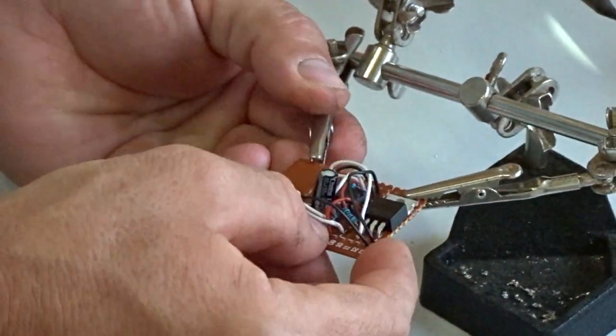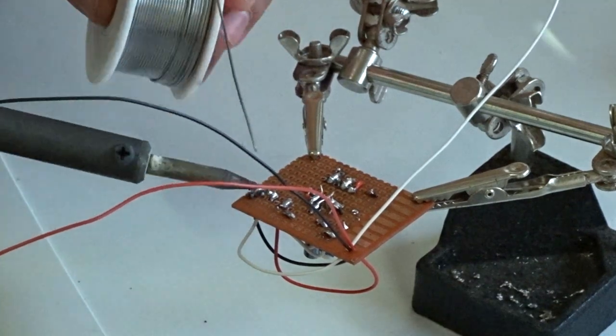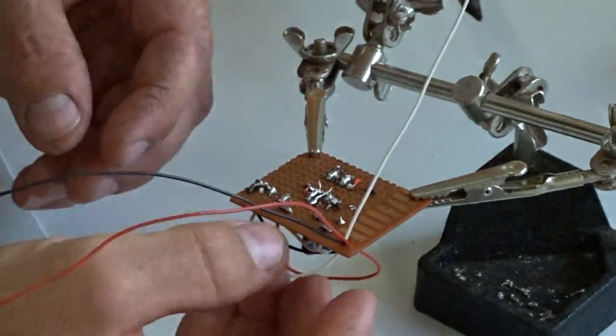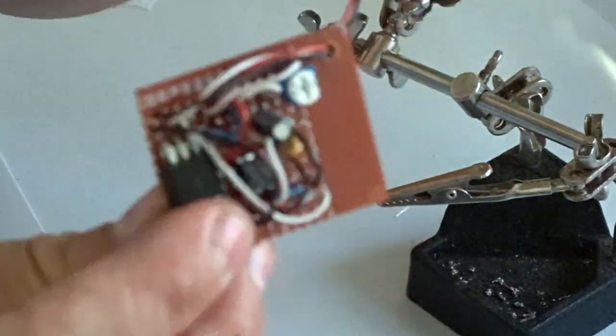One extra wire from the previous video. The red wire needs to go to 12 volts, the white wire goes to the cut relay instead of the push button switch, and the black wire is grounded by the push button switch. Basically, this circuit goes between the push button switch and the cut relay to time your cuts for you.